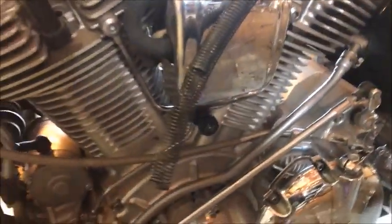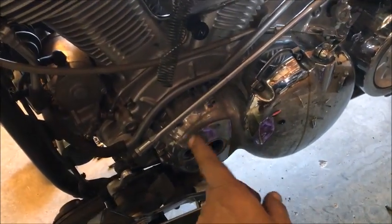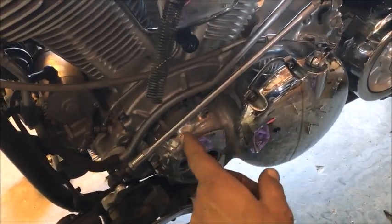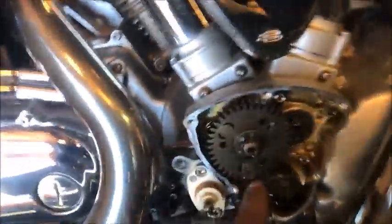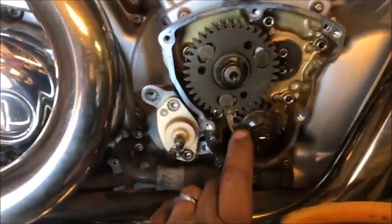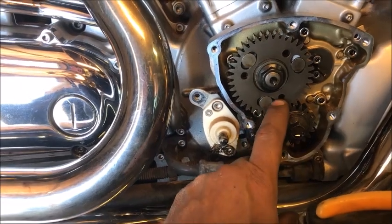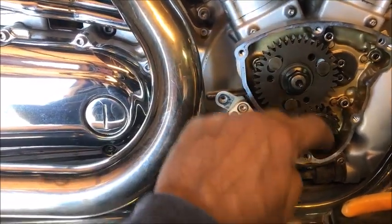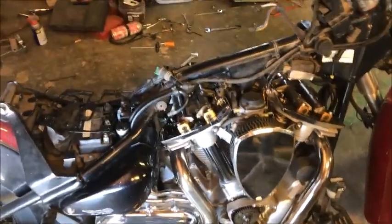So essentially, when you put the socket back on here and you rotate this counterclockwise, one full revolution and then a half revolution, you're going to hit the one mark, and that's where you're going to do the second valve lash clearance. And what you will see over here, I haven't done it yet because we're still capping this off, is this crank timing mark will be down here and this cam timing mark will be up here. They'll still be straight in line, but it'll be up here and down here instead. So make sure that you turn that counterclockwise before readjusting the other valves.